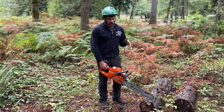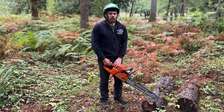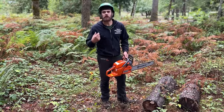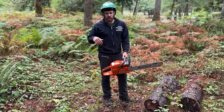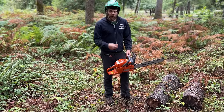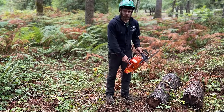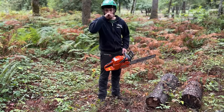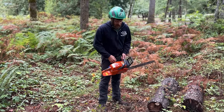So we just talked about starting the saw, and I showed you an ideal situation. It fired right up. But sometimes you might be in that situation where you're just pulling and pulling and pulling, and it's just not happening. What happens a lot of the time is, if you remember that initial burp that I first got, if I would have kept pulling the saw, I'll do it right now. I'll just flood it for you. So choke on, chain brake on. Okay, so it burped, everything's going good, but what happens if I didn't hear that, and I just keep pulling?